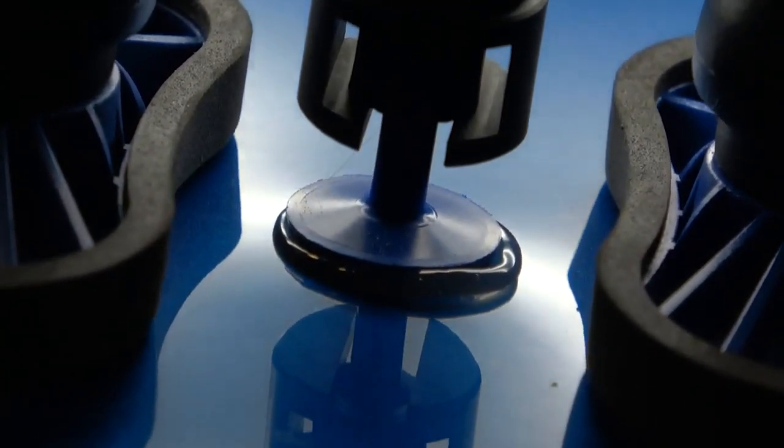Remember, as you work through your repair, the original large damage will become several areas of smaller damage. You'll need to either address these with extensive filler work or an increasingly smaller tab and tool selection until you reach your desired repair state that satisfies your expectations and the expectations of the OEM repair manual.